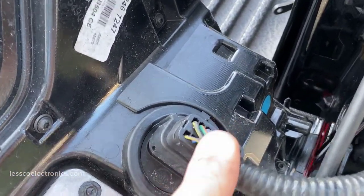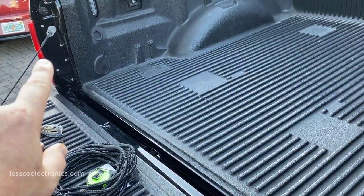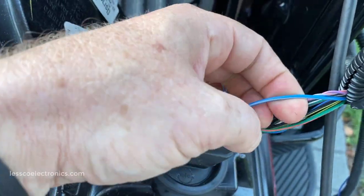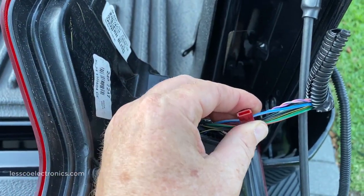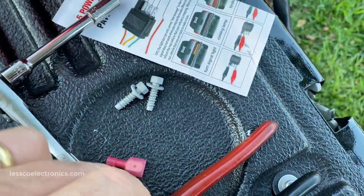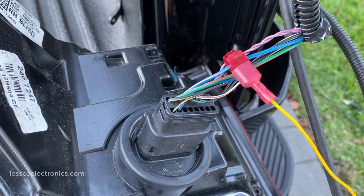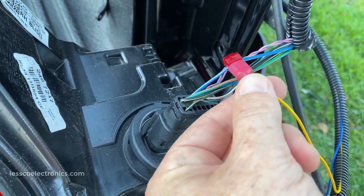I've already noticed that blue-white is my parking light wire. I'm going to find my right directional and my reverse on this side, and I'll run the left directional over to the other side. Now I've got my harness out here ready to get wired up and some of the factory loom pulled back. For the connections: blue-white is running lights. I'm going to take a t-tap — it just clicks on there like that and provides a female terminal. Then an 18-gauge insulated male terminal slides right in. I'll do that for the three connections, and for the ground I'll grab that bolt right there.